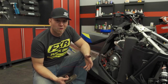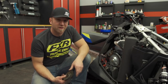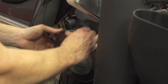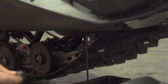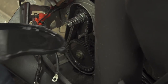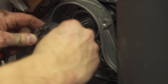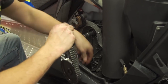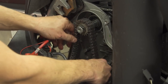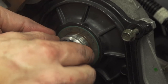If you haven't done gearing before, it can seem like a daunting task, but really it's not all that hard. Just make sure you do it with a cold pipe and a good oil catcher. On the Evo we don't have to take off the pipe at all, but we will need to get rid of the battery, battery tray, and the disc brake setup, running off a spline stub sticking through the chain case cover. With this stuff out of the way, drain out the oil then remove the cover. Once inside, it's mainly just remembering where everything went — take pictures before you remove everything — then simply back off the tensioner, unbolt the lower gear, and it all comes sliding off. Swap out your stock gears and simply retrace your steps to get it back together. And finally — never, ever, ever forget to put fresh oil back in the chain case.